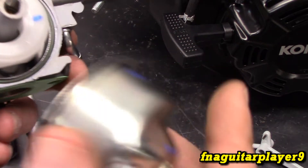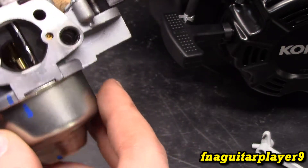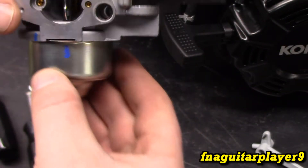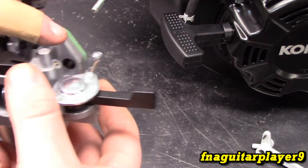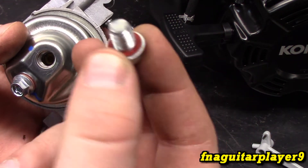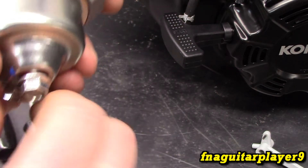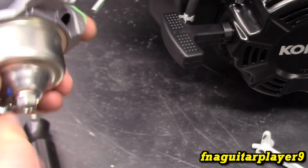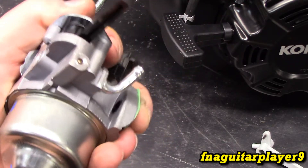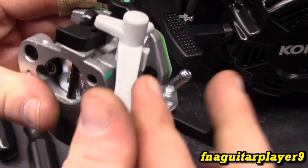To put the bowl back on, you usually want to put the drain plug away from the needle valve and also in a spot that's easy to get to — which is why it was offset just a little bit, so the drain plug sticks out where you can actually reach it. Make sure the seal is on the bolt. If you lose that seal and can't get the actual part, you can get by with an O-ring — just don't tighten it too much so it spreads out. You can also use a flat seal or a copper seal like what you see on brake lines. Then put the choke back on and make sure it works.